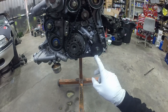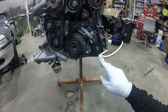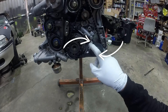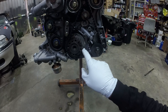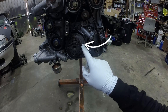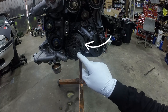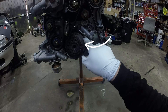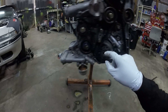Looking at the timing marks, we'll start out with this balancing shaft pulley right here. There's one arrow right there where the white is, and that's the arrow it goes to over here. You can see the white marking that goes to it, and if you look at any other of the markings for this, it goes to this little arrow right up under this bolt.